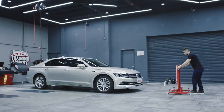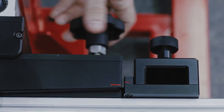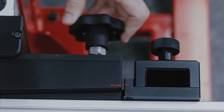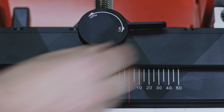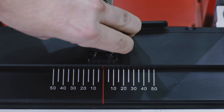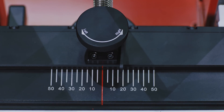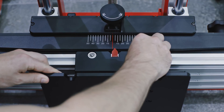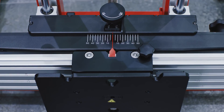Place the calibration frame on a level floor in front of the vehicle. No pattern board should be attached to the frame. Rotate the fine tuning bolt until the marked lines are aligned. Loosen the handle and then rotate the fine tuning bolt until the scale value is zero. Tighten the handle to secure the crossbar. Align the pointer on the sliding plate with the marked line, then tighten the bolt to secure the sliding plate.